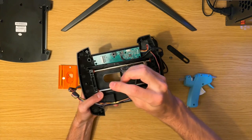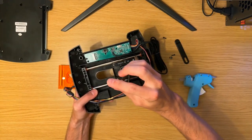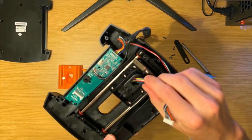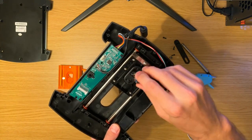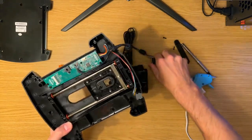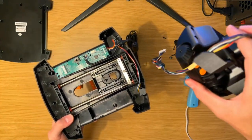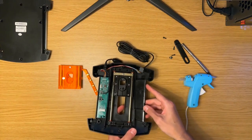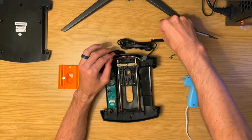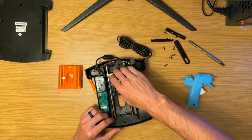Next come the three screws in the actual slider itself that are going to remove the handle. With those three out, we'll go ahead and lower the handle through each of these metal spacers. The handle's completely free; we'll move that to the side. Next come what I call the rail clamps — these pieces of plastic on the foremost and aftmost portions of the rails. These are what hold the rails and slider into the case. Clamps removed, we can now pull this out completely.